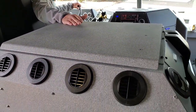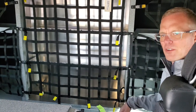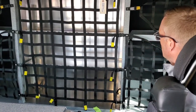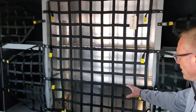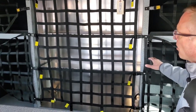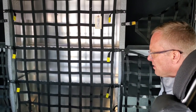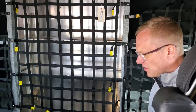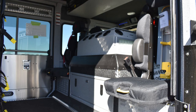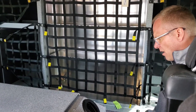I'm sitting in the rear-facing outboard driver's side seat. The whole back wall has been customized for the customer's requirements — power leads run into these cabinets, adjustable shelving, cargo webbing, and a lot of thoughtful design in the compartment layout. The Sutphen chassis has a shorter front overhang, which brings the engine tunnel back so it essentially terminates at the forward door hinge of the crew area, offering a nice drop-down access door into the engine compartment.